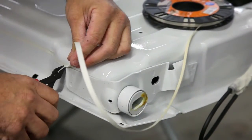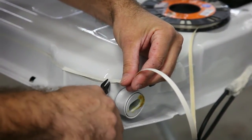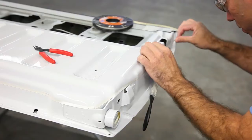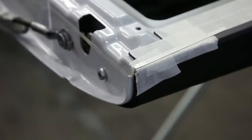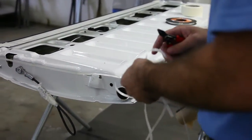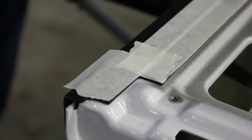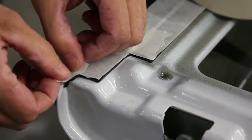Notice how the technician uses a snipping tool to create small relief cuts in the wiretape to allow it to work well around curves and corners. Continue around the entire tailgate until complete. It's important to leave a 6-inch extra tail of wiretape so it can be easily grabbed after spraying. Peel the backing off the wiretape that was just applied. Notice how the technician uses small pieces of masking tape to cover exposed hardware and latches to ensure that no overspray contacts the mechanisms.